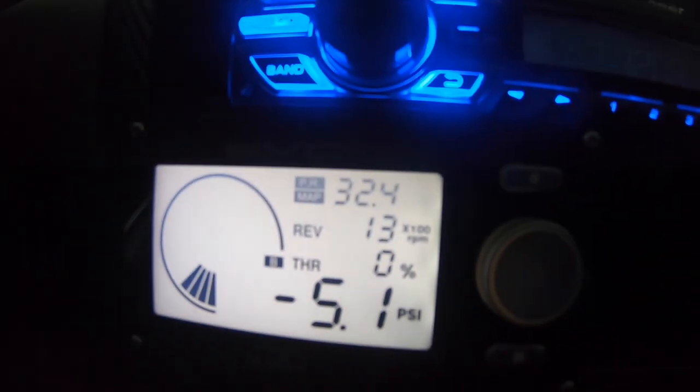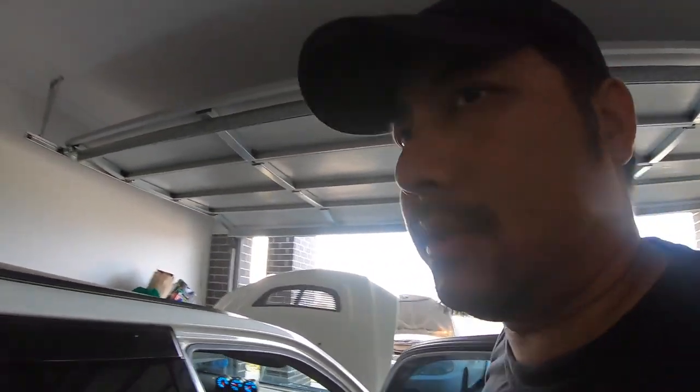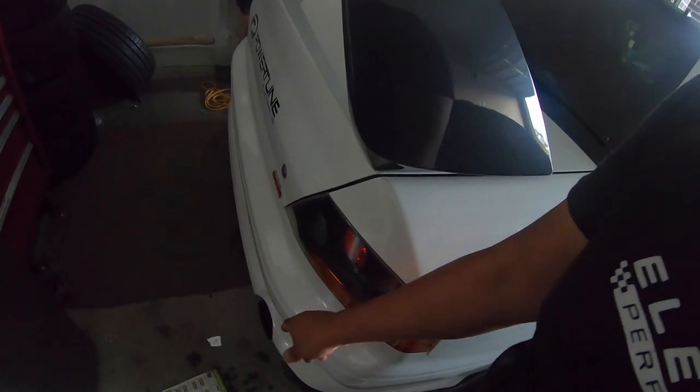We're sitting right now at about 1300 RPM. It's been about 2 minutes. And now that popping sound's gone. So that popping sound only happens for about a minute or two, so I'm not too sure if it's my cold start issue. See? So that's what it should sound like.